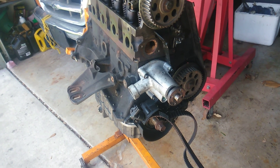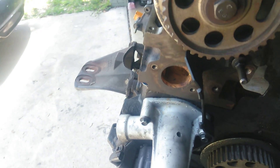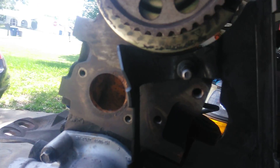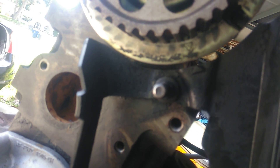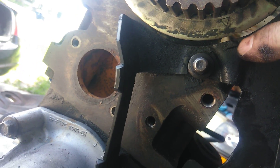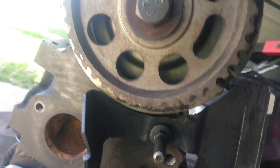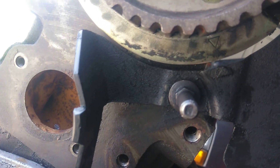I'm going to start with going over where the timing marks are. On the camshaft, you're going to line up right down here on the cover — it's going to be a triangle. There's a triangle here and you line it up with the inside cover triangle. You do not use this indention here and you don't use the diamond up here. It's going to be the triangle against the triangle.